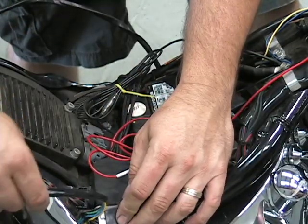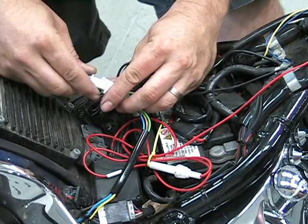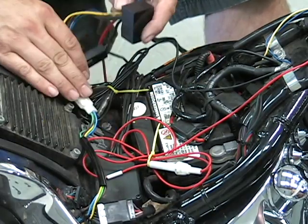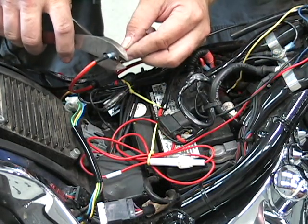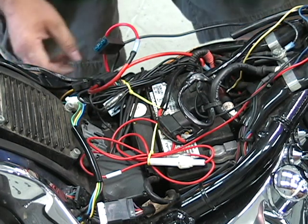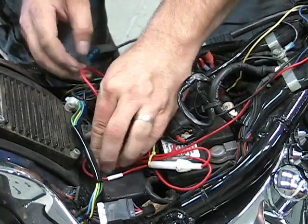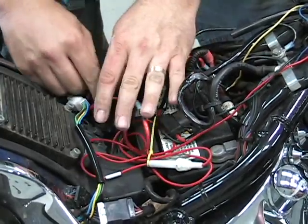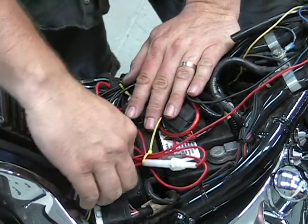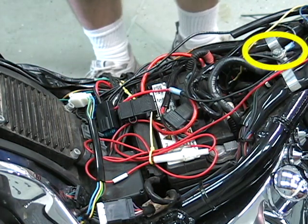Finishing this project is down to just two steps. First, I'll pull out the sub-harness and attach the relay kit. If this were a 4-wire kit, remember we have that extra piece, I would attach that to the sub-harness and then connect in the wiring harness that we just created. After this, I'll wire it to the battery. That can be a challenge on a bike like this where room is tight and you already have a few things attached to the battery. I've already attached a fused lead to the positive terminal of this battery. I'm going to attach that to the red lead on the relay package to power it. This is going to drive the lights on the trailer — and don't leave out this fuse, because if something happens to the trailer wiring that causes a short, it's going to be this inline fuse that blows out and leaves the rest of the bike's lights untouched. The ground lead can go to the negative post on the battery, or to the frame if the bike uses a frame ground like this one.